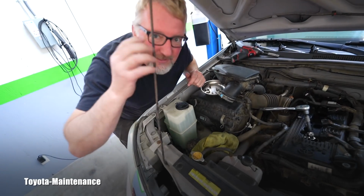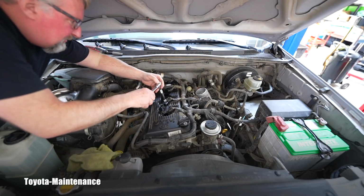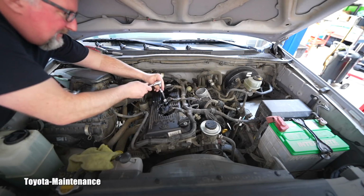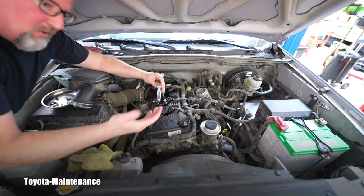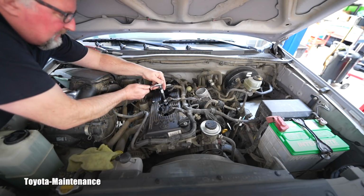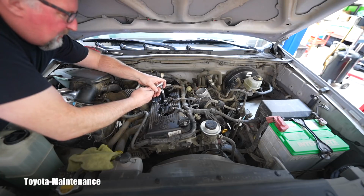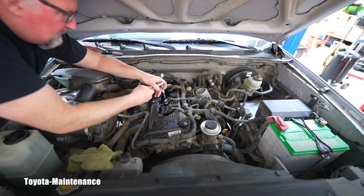So it's so cool how Denso actually tries to help out DIYers. They are not asking you to own a torque wrench, but they are just helping you with the turn. They are saying either a quarter turn or maximum half turn, and that's how you feel it's correctly torqued.